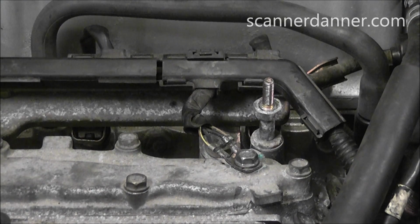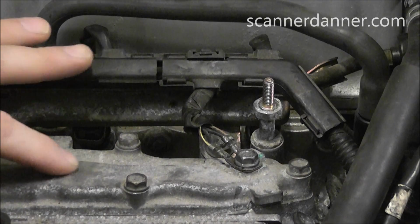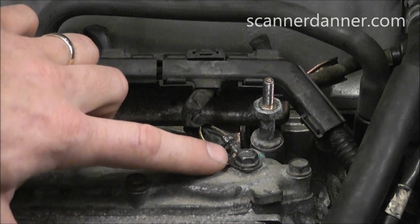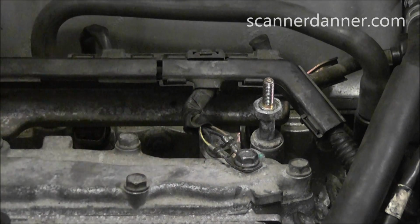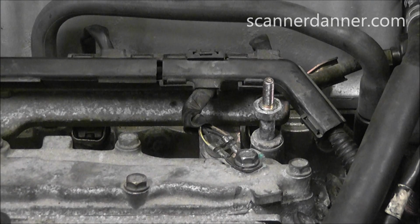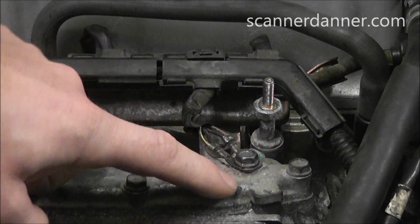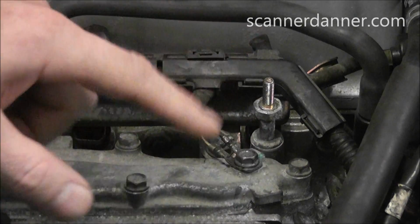And I've shown this before. The last vehicle that we had, I think it was a Toyota Echo, ran but had bad computer grounds, if you guys remember from that video, and it had to do with a salvage yard engine. This aluminum housing oxidizes, and then you bolt the eyelet onto an oxidized housing and you have a bad ground. So can we quickly identify this ground connection without taking the bolt off and cleaning it up? The answer is yes. It's very simple.